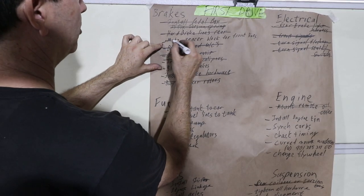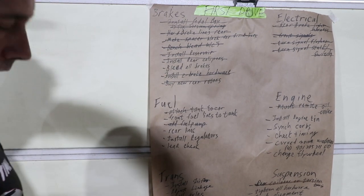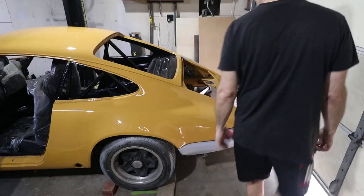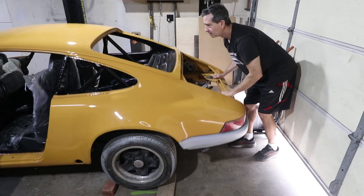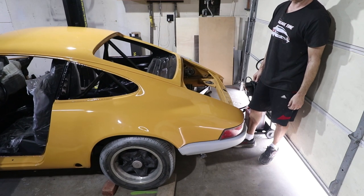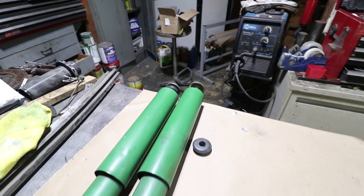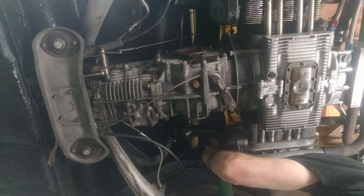So that's the spacer block for the brake lines - that's done. The only thing left on the brakes is to bleed the brakes and I cannot do that yet because I don't have the rear brake pads; they're back ordered. There's one more thing I can do today that's also pretty easy, which is install the rear shocks. This is your car without shocks. I have some used Bilsteins that I think are rebuildable, so I'm going to just put these on for now - they're better than nothing and we'll work out the coilovers in a future episode.